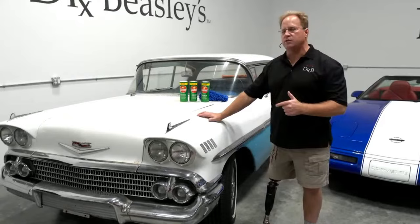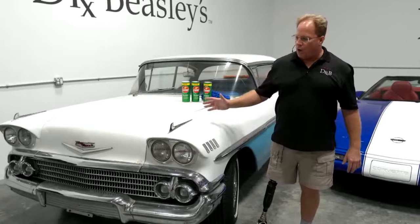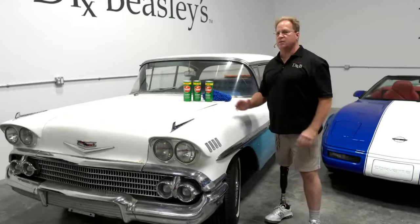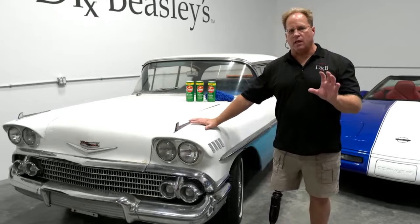But you have to keep in mind, after we wash this with Comet and basically exfoliate, kind of liquid sandpaper, exactly, liquid sandpaper, after we exfoliate all the dead paint, we're going to buff this out with wool pads and rotary polishers. So any scouring that takes place with the Comet is going to be removed from the first step. What I teach is multiple step show car detailing. We start with wool pads, first thing, first day. All right, move on to the Vette.